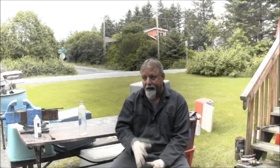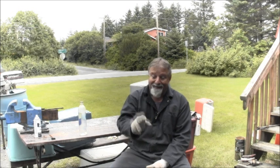But that one has a thrown rod, and I don't see where that really does me any good, because this one with the stuck piston, that cylinder head, could I hone it? Yeah, but then take the pistons and whatnot out of the other ones and put in the submerged rusted power head, possibly, but it's not something I would sell to anybody, so I'm going to put it on the back burner unless I can find a decent cylinder head, or cylinder block for it in my pile. I don't think I have another, but I am going to look.